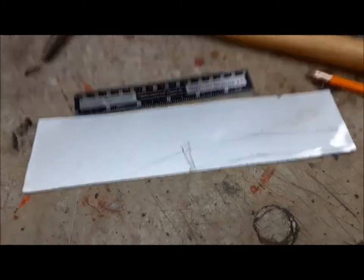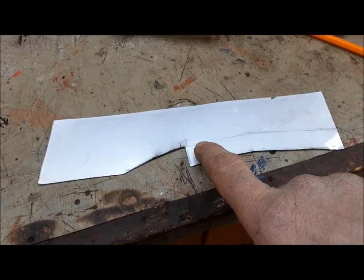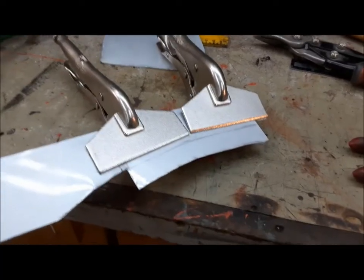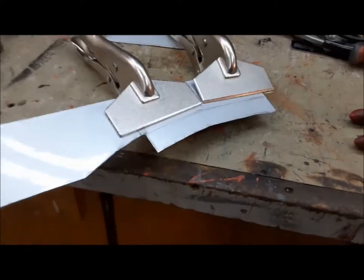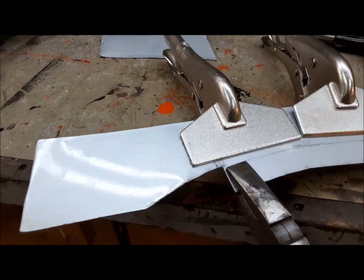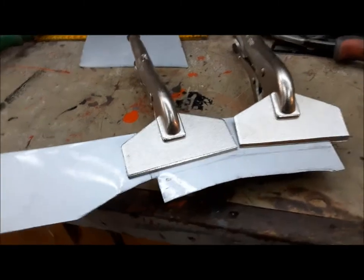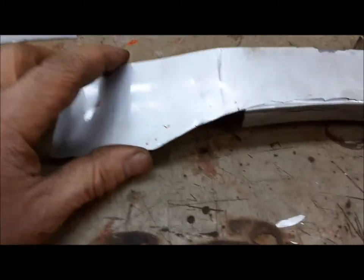First thing I have to do is take this little triangle out, then we have to nip this little sliver out here. Now I have to bend this flange — it can be a little tricky because I'm trying to bend it 90 degrees but at the same time going around this little arc here. Keeping in mind that I am not anything even remotely close to being a body man or a welder or a sheet metal guy — this is just stuff I've picked up along the way from people that actually knew what they were doing. What I'm going to do is hold it with these two flange clamps. Then you just get a pair of linesman pliers and you just slowly work your way back and forth and just bend it a little bit at a time. It will never be perfect, but for an inner panel like that I should be able to get it close enough. It fits over what's there pretty nicely, so I think we're on the right track.